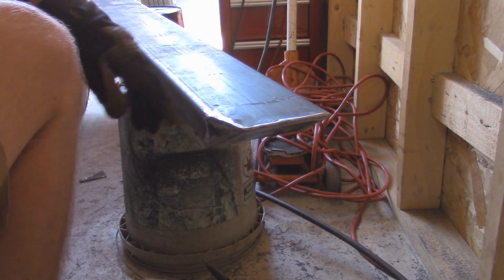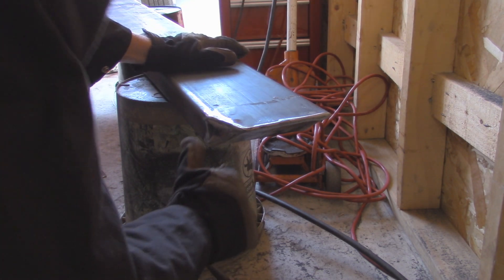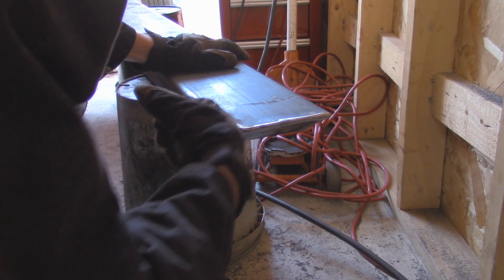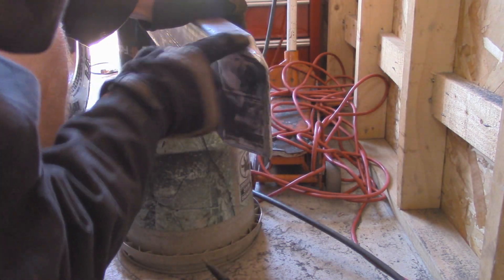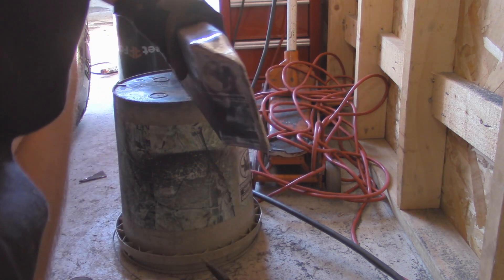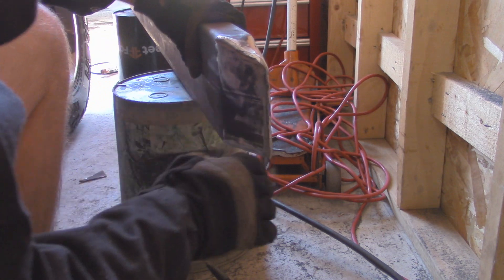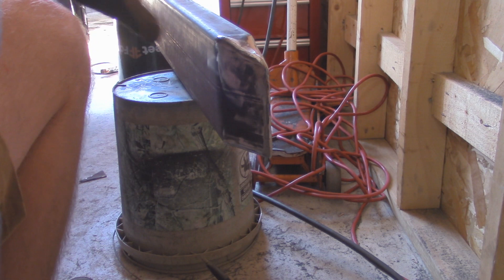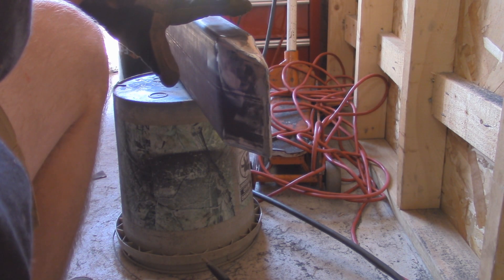Alright, so this is the finished result over here on the front side. I got everything ground down and rounded — overall it looks pretty well. There is a little bit of a weird kind of U shape with this little tab I hammered in — I hammered in the middle and it kind of bent into a U, so I wasn't able to get that out. But I don't think anyone will notice too much. There are a couple little divots from the welds — I went back and just kind of plug welded down any major ones that were in the way. But once we add paint on here it's going to look pretty much good, and most of this is going to be covered by the fender anyway — all you're going to really see is just this outside piece. Now that we got this front side done, I'm going to let it cool off because it's actually really hot right now. We'll measure it out how long this needs to actually be and then start capping off the rear end.